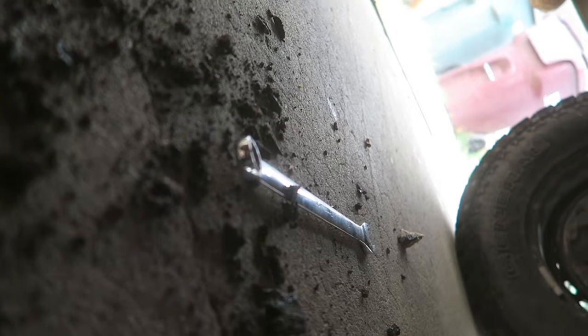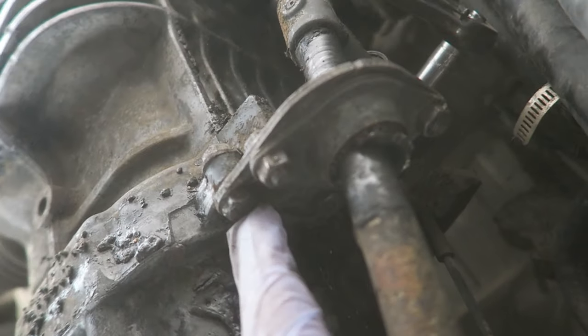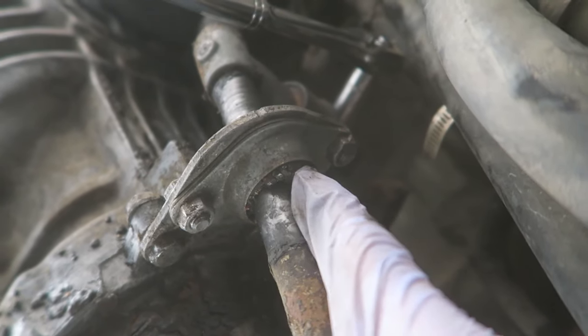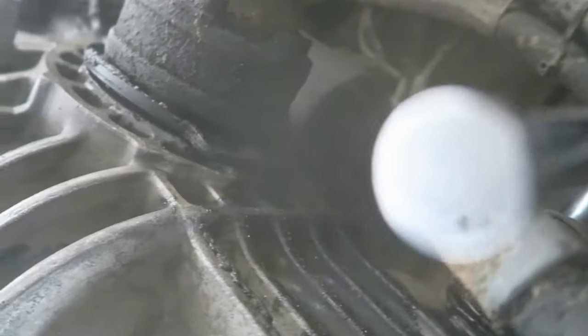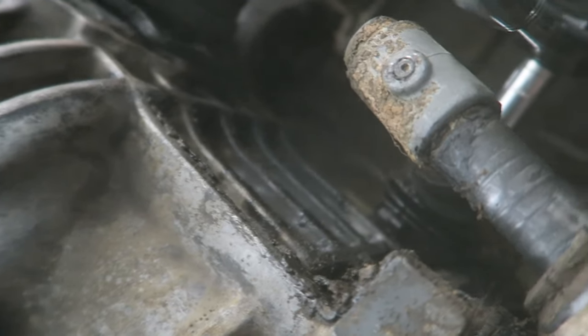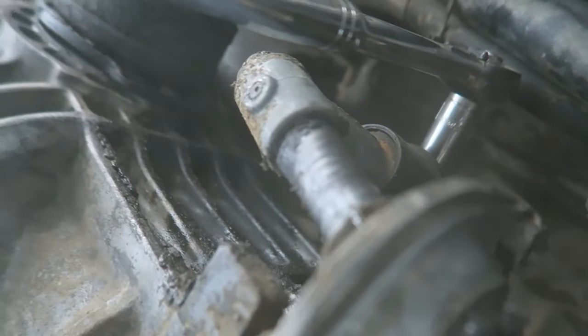I don't have too much room to film under here, but this is a bunch of grease and debris and dirt that I knocked off of these bolts, which I'm going to be removing. There's one right here which is a 13, and one a little higher — it's a 13. It's a bracket. We need to get the selector arm off up there, which is also a 13. And yeah, there's a roll pin you got to press out or push out, and we'll get this whole rear part of the system off.